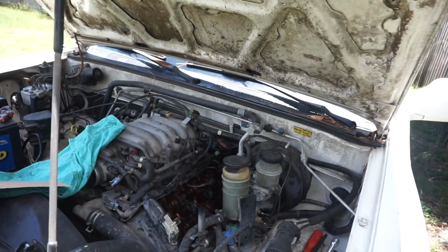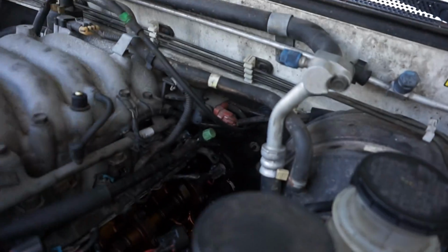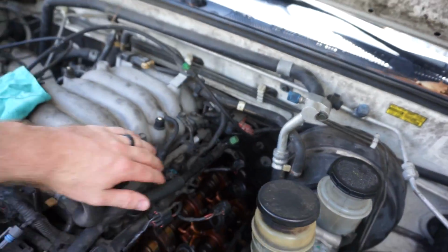A lot of people online have been trying to make cut off Allen wrenches and a bunch of different other options to get the valve cover bolts off, because they use an Allen head, a 5mm, and one of mine was rounded out enough I was able to use a 5.5mm one that I got at Harbor Freight. And the driver's side is very hard to get to, especially the back bolts, as you can imagine, with all that being way back there behind the brake booster.